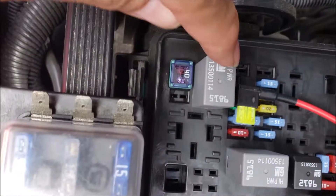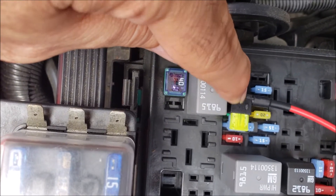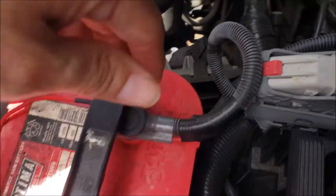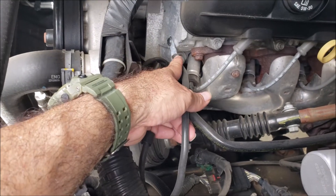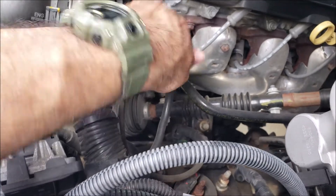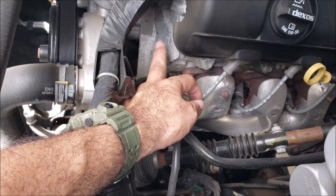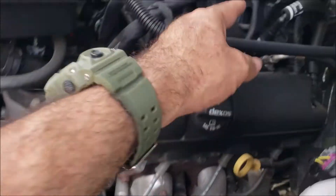That's the actual second fuse right next to this big relay. Put a 20 amp on there. Now as far as grounding the battery, I wasn't real specific about how I did it — I grounded the battery to the block. Most blocks are going to have a threaded input on the heads, usually on both sides and then in the back.